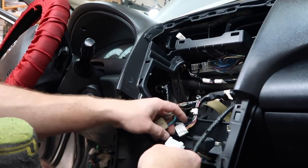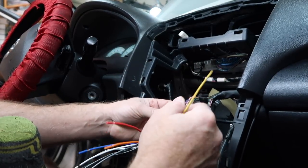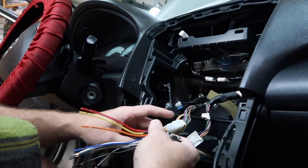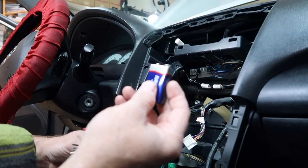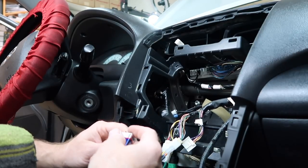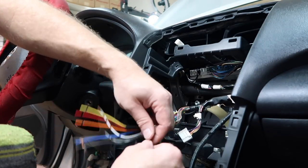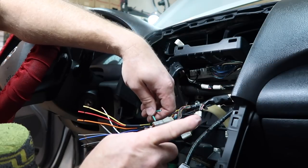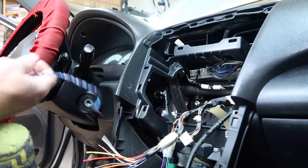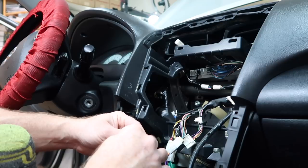So let's go into the car. The first thing we want to do is go ahead and plug in our plug. When we do this, we want to make sure that we keep this yellow wire — which is constant 12 volts — away from any metal, and we'll go ahead and plug in our rear harness. The reason why we picked up a nine volt as well as the tone generator is because not everyone has a tone generator, but most of you guys have a nine volt, and a nine volt will work for what we're trying to do. We want to just pop these speakers and make sure we get sound out of them. Now, the reason why I brought the front and rear harnesses is because in some vehicles — very few — some have an amplifier just for the rear speakers, so we want to test those. Those work too. Now if you had a tone generator, you could do the same thing.